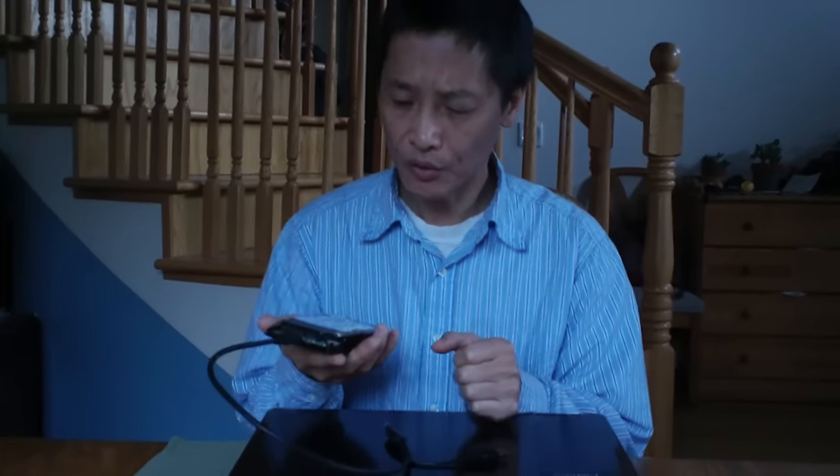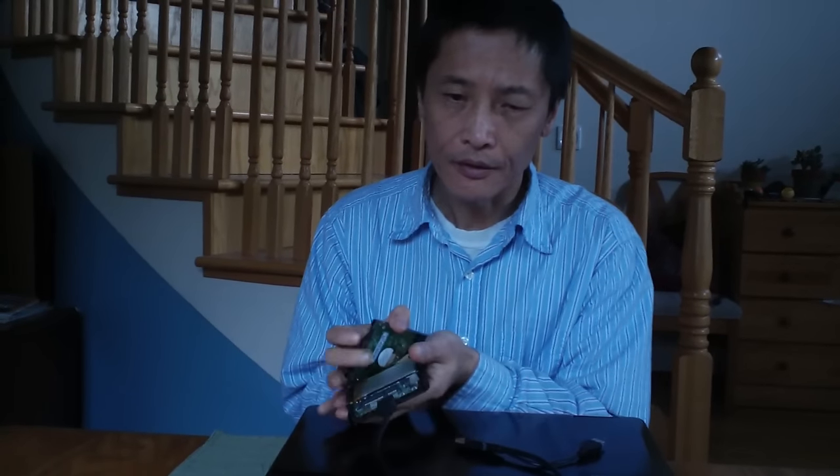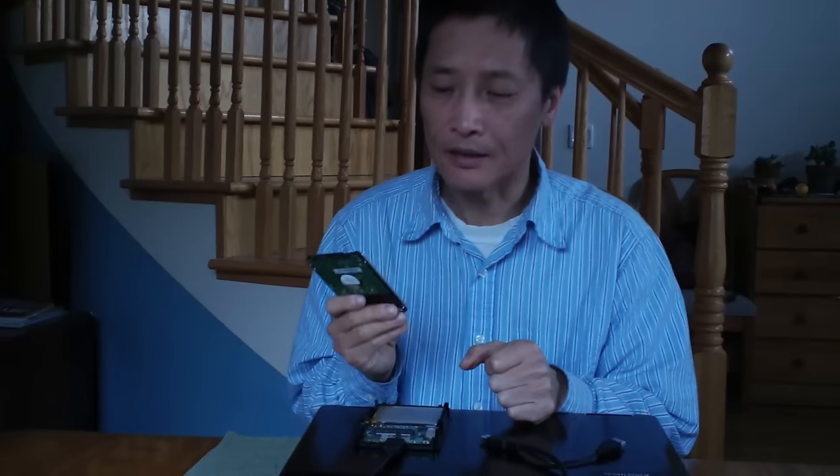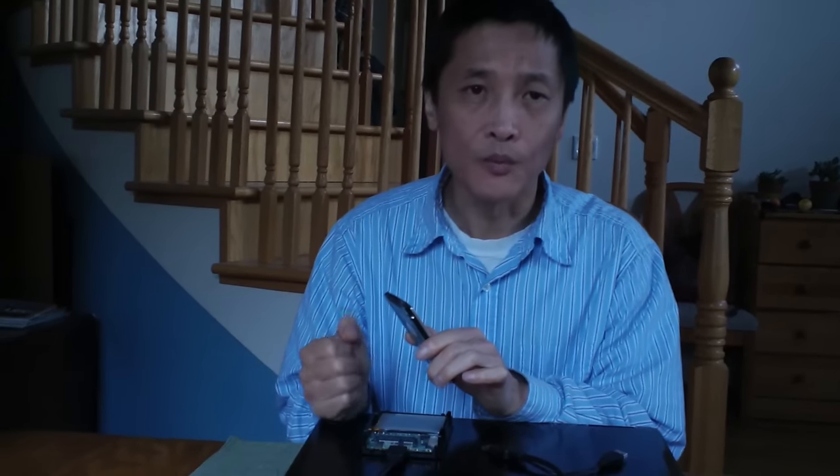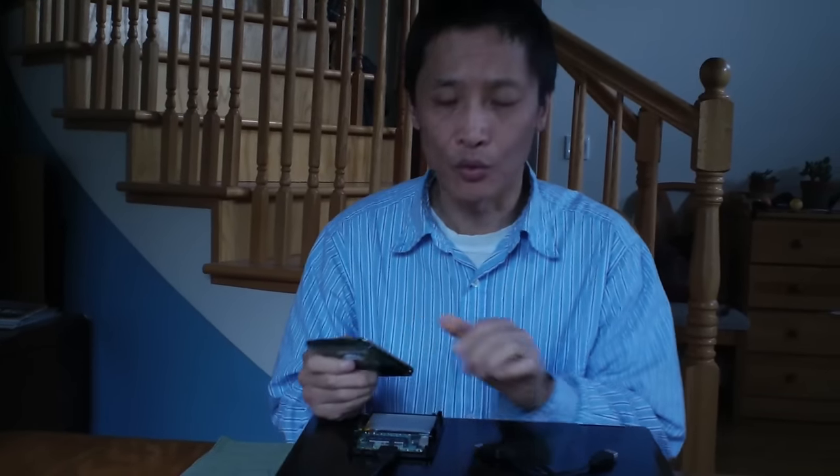If you don't have this kind of enclosure, you can check whether your PC has a SATA interface. Take the disk to your PC and open the case to see whether you can attach it to the SATA interface. If you don't have a SATA interface and only have IDE, there are converters you can use to convert between the two.